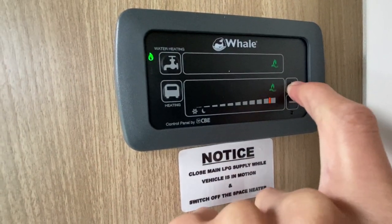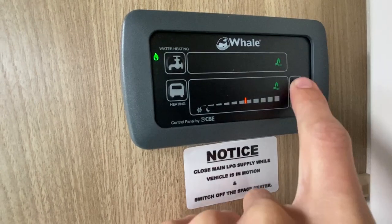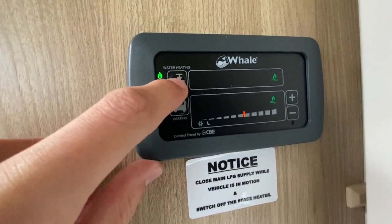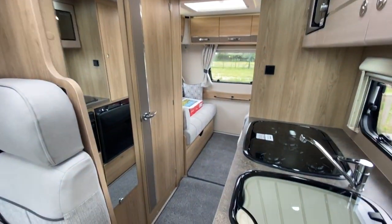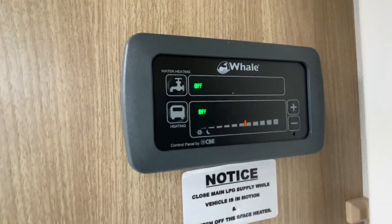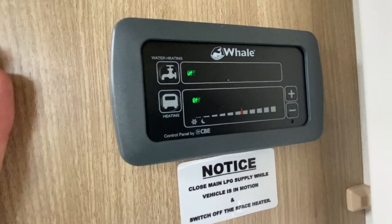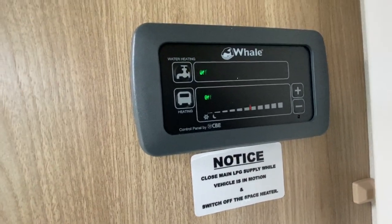The plus and minus is your temperature — the top is 30 degrees, in the middle there is about 15, and you can then turn it down. We do advise that you turn the systems off and allow the fan to go quiet before you start the engine, as this gives the boiler system the time to do its correct cycle for closing down.